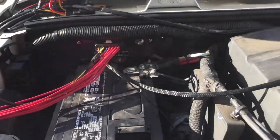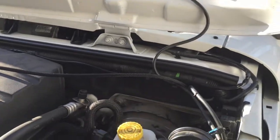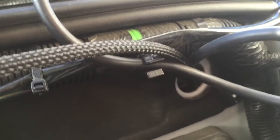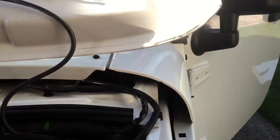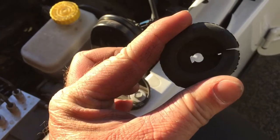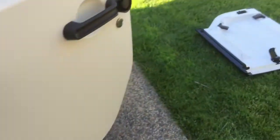We took the plug wire — it's just laying across the engine right now. We're going to attach it to the wiring harness on the back of the firewall, and it'll get zip tied there. We ran it through the pass-through grommet — the same one the windshield washer fluid for the rear window goes through into the cab, so it's easy to find. I took the grommet out, cut it along one side so I could remove it, then clamped it back around the wires and pushed it back in so it's one piece again, with a slightly larger opening for the wires.